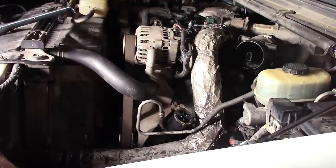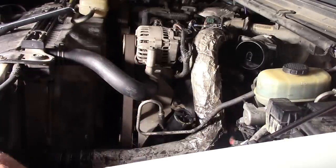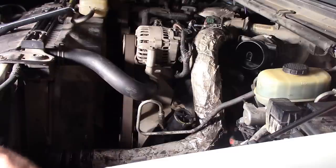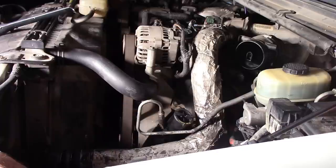Off camera I started the vehicle up and added power steering fluid until it was full, turned the wheel both directions a couple times slowly, kept checking to make sure it was still full, topped it off, then pumped the brake pedal a few times, checked fluid, pumped and topped off. I didn't want to do that on camera because this diesel idling in the garage is pretty loud. Everything's back together and there are no leaks anywhere — yet. We'll have to give it time to make sure none of the remanufactured stuff is leaking.